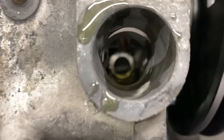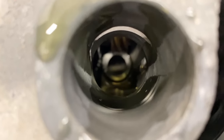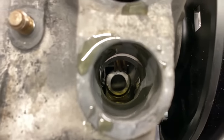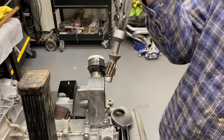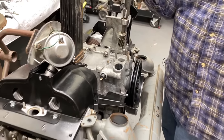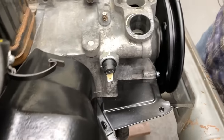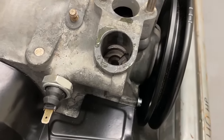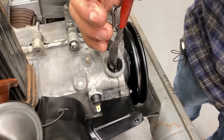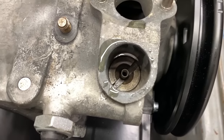There they are. Drive gear pliers. Nice. So there, I got the gear in my hand there. So this is the distributor drive gear. Right. You got these awesome pliers. Now, this is going to want to turn a little bit as you put it in, so you want to come a little past where you want it. Okay. Gotcha. So as it goes down, it turns with the threads. Right, as it engages in the gear. Yep. So now, spring's next. Drive gear's installed. That wasn't too much drama. No. So that's pretty much how I do it.